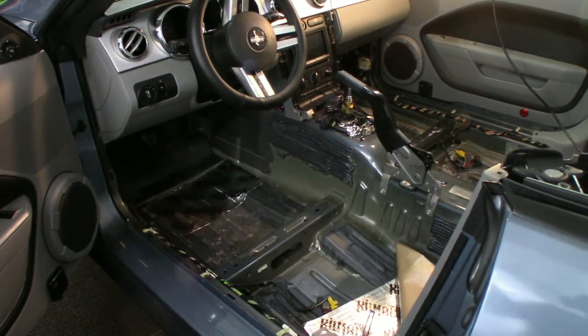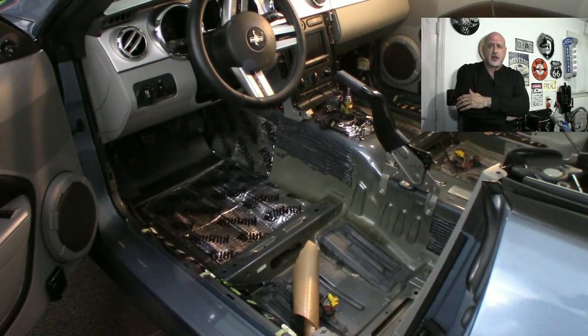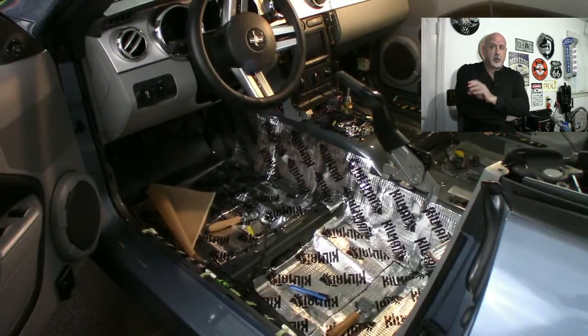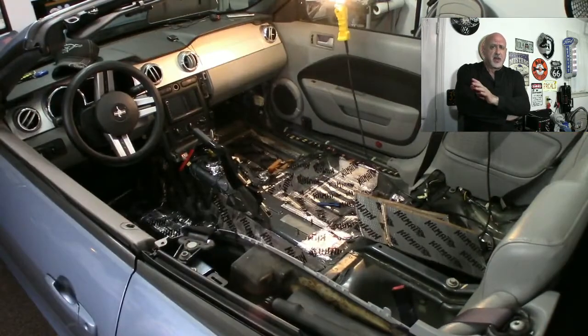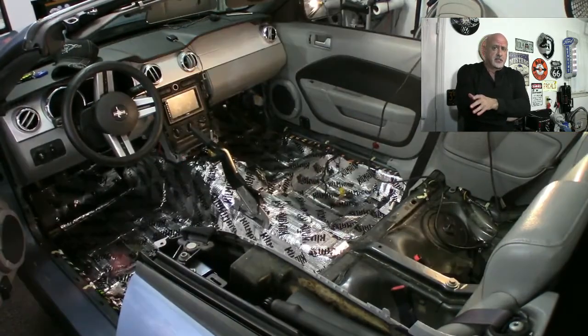I've laid the first piece down. What I find interesting about the roller with the grooves is it leaves marks in the tin foil — this way you can see where you have and have not rolled. The sound padding is going in pretty quickly; every couple of seconds you'll see it change. We're going to cut the video here and continue on with the next video, so we'll catch you soon.